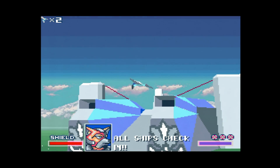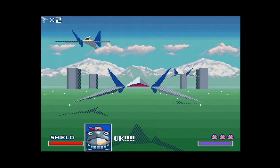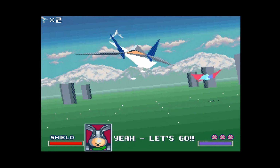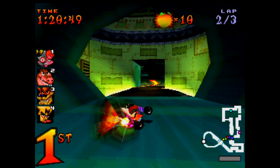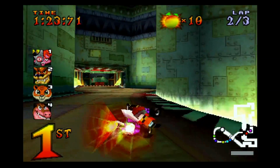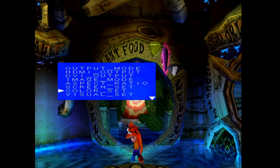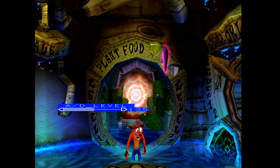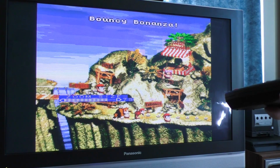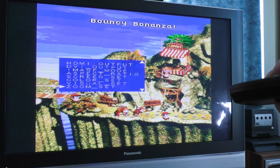The biggest selling point for this unit for me was simply the amount of functionality it brings to the table. While the default settings are very good, built in are a lot of options for tweaking the incoming source for an even higher quality capture. Settings for saturation and contrast levels, black levels, sharpness, and the main one for me being the zoom function, to remove that annoying overscan and get the image centered just right into the correct aspect ratio.